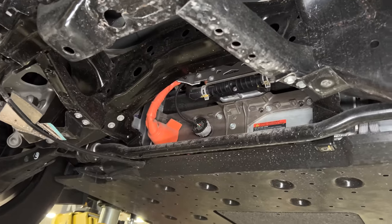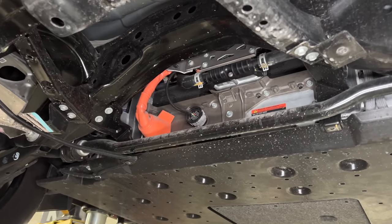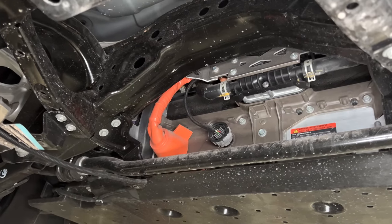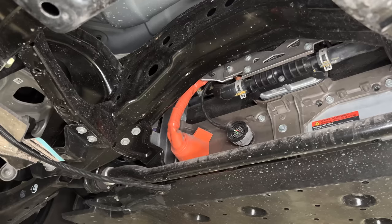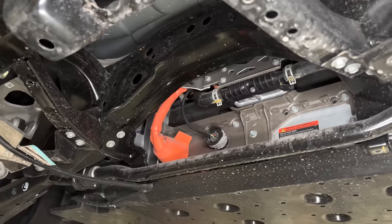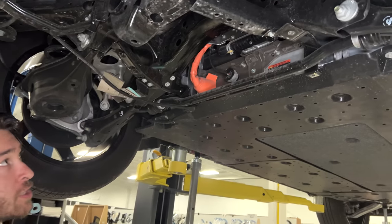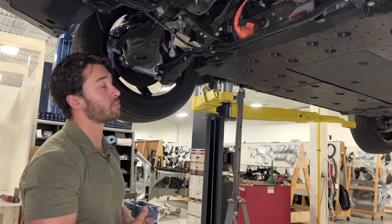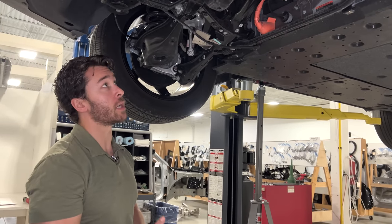On the backside, other than that, there's the high voltage connector here. It's not straightforward as to where that goes, but immediately looking at this, it looks like the PTC power is being supplied directly out of that port from the battery pack. If that's the case, that's a fairly elegant way to do it. Normally there would be a separate high voltage cable run out of a DC-DC converter, similar to what would be powering your EAC compressor for the thermal management system. That allows a fairly short run and a direct integration. The high voltage cabling can be expensive, so the less of that you need, you're going to be able to garner some cost benefits there.